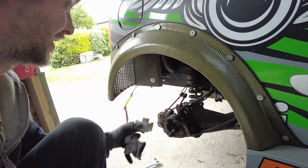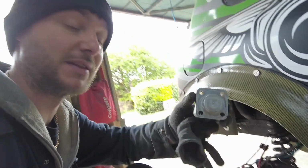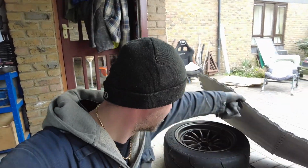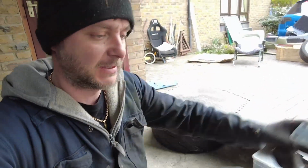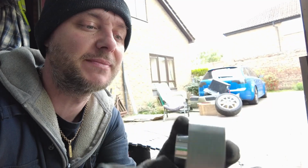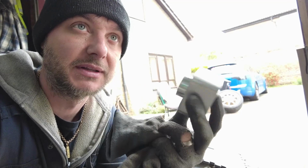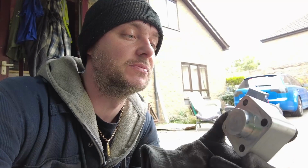Anyways, next job, like I said, we need to reduce the track width of the rear wheels, because we're using 225 tire on those wheels. They are offset 0. Those are the spacers that I had previously fitted. Those are 40mm spacers. I've calculated I need to reduce this by 25mm. I might need to chop the arch a little bit, but essentially this needs to be 25mm smaller. So I think I'm gonna take it onto the lathe and take 25mm off. Good luck.